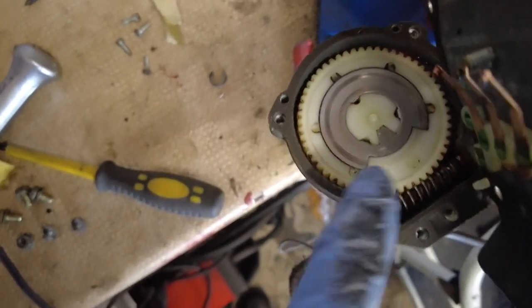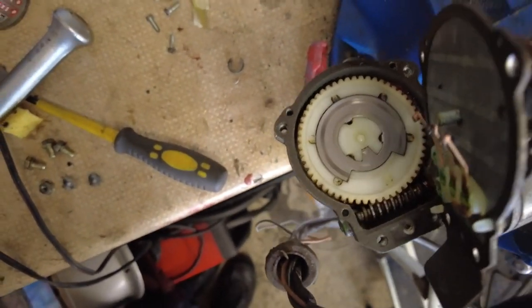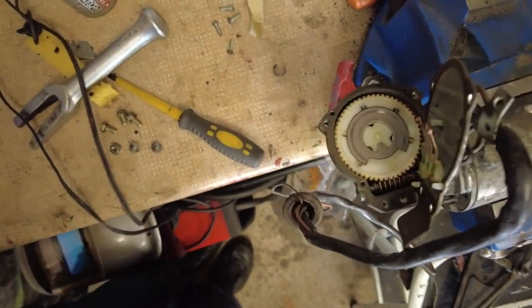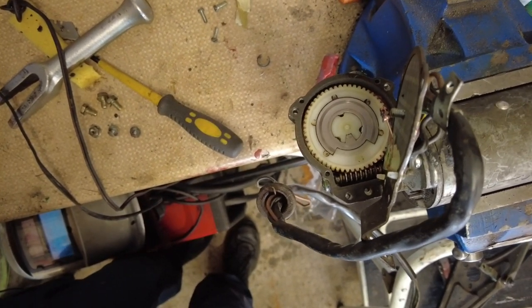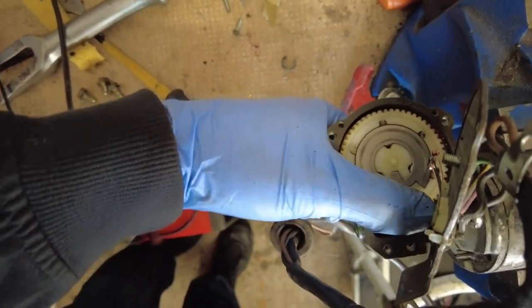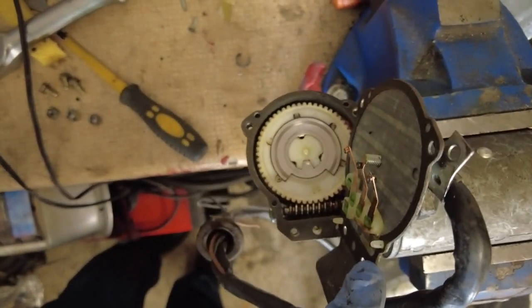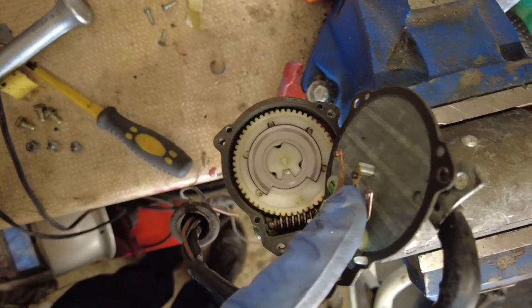Quick clean off and now you can see exactly what I mean. So basically that's the position it parks in — that is the position we're going to put it back into. Well, to be honest it doesn't really make a difference because once it parks you just reposition the crank to the right place and it will turn off. So let's get that out, lubricate everything, clean the contacts there as well, and put it all back together.